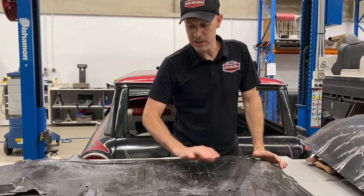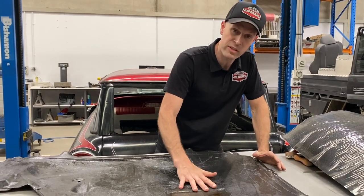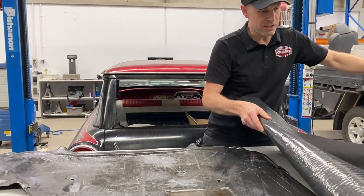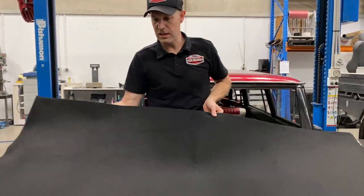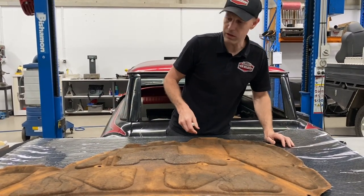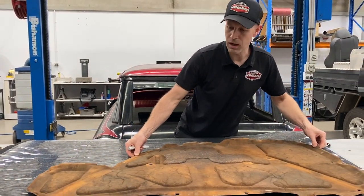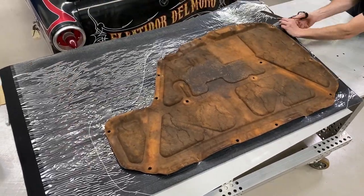You can see we've got a nice sealed surface. A good way to test it is to get a bit of masking tape and stick it - being a self-adhesive material, it will now stick now that it's sealed. We've got our premium underbonnet here, which is a self-adhesive product - you can see it's 100% black. It's nice and oversized for our sheet. I'm going to flip this over - there's a white texture on the back - and trace it. I'll leave it oversized because it's going to shorten up as we roll through all the valleys. I'll rough cut it for now.